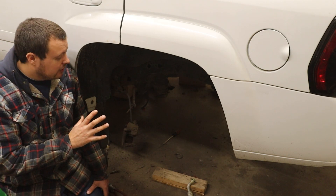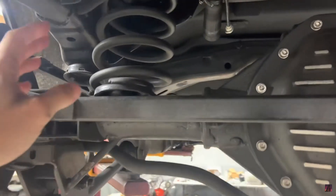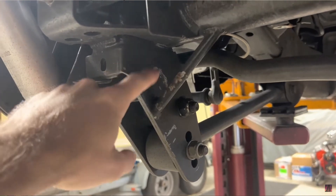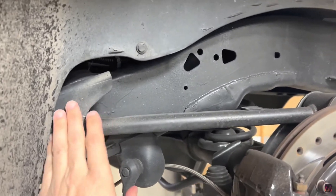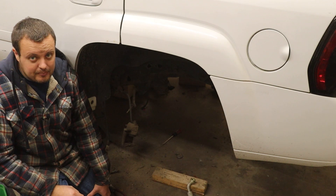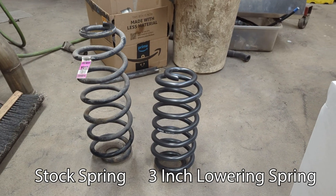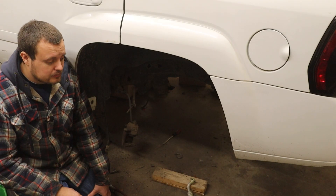A brief overview of what he did: he basically installed a Belltech two-inch lowering kit onto his Trailblazer with a set of their shocks, then installed the PCM of North Carolina lower control arm relocation kit, still using the factory arms. The thing leaves like a dream, and that's exactly what I'm looking for. We're going to make a few small tweaks — I'm going with the three-inch lowering kit to get this thing closer to the ground, but that shouldn't affect the launch too much.